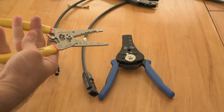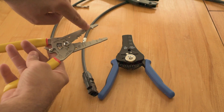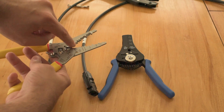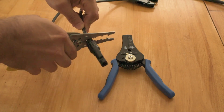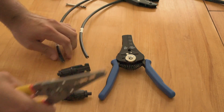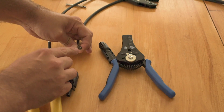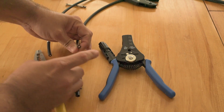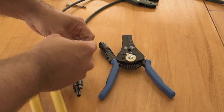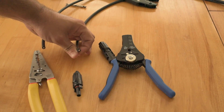The way we do that is we take our wire cutters — you cut with this part right here, not with the clamp up here. These are strippers for 10-2 or 12-2 household wiring, so you ignore those. I just use the cutters here and I'm going to cut the end off. Boom, done. Do the same thing for this one. Now you can see the exposed copper in there. You can see how thick the insulation is — these are really heavy-duty cables and it's stranded wire. Stranded wire gives you maximum electron throughput because electrons travel on the outside of the copper, so if you have more outside surface area your cables don't get as hot and can carry more current.